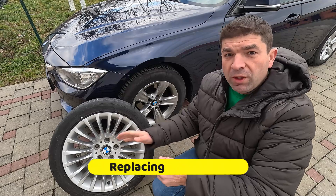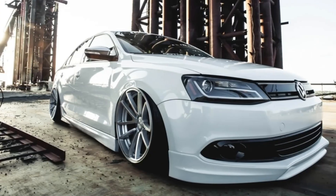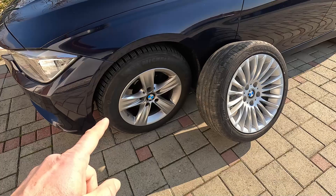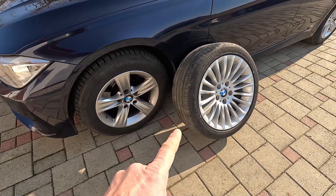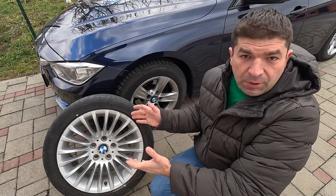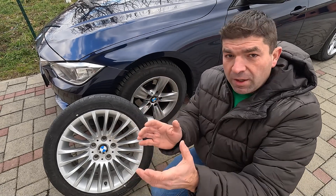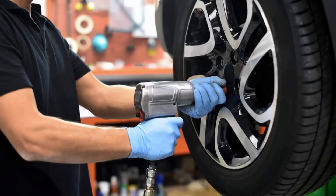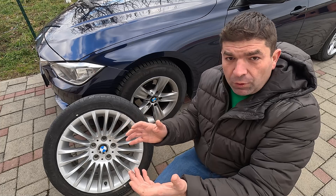There's also a situation when you've replaced the wheel for whatever reason — maybe you damaged them in an accident, got some sort of an upgrade, or just swapped from a winter set of wheels to summer ones. All of this can result in TPMS problems and a tire pressure warning on the dashboard. In most cases you'll have to simply reset the TPMS. It's much the same when you get your tires rotated or fit a set of new ones. Most reputable tire shops know all about this and will take care of it for you, but they might have overlooked it if they were in a hurry.